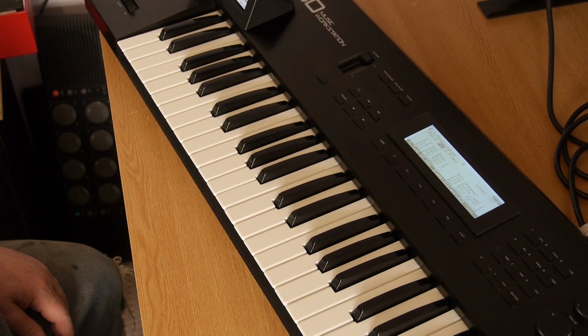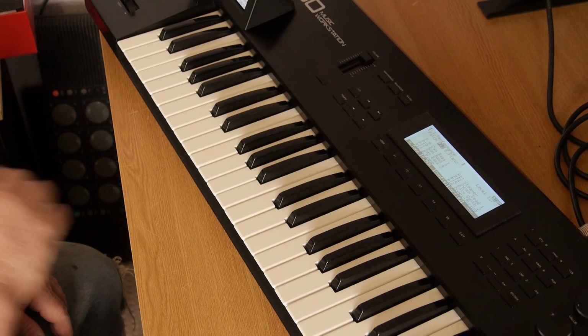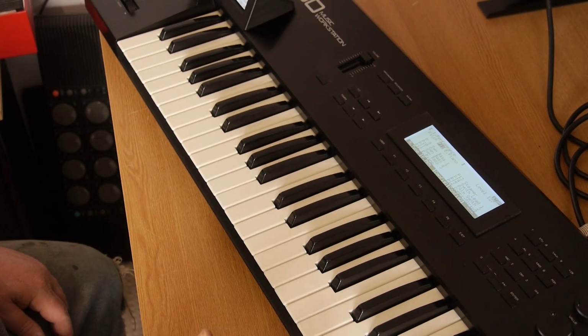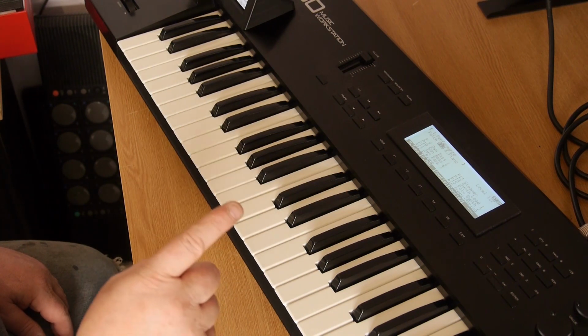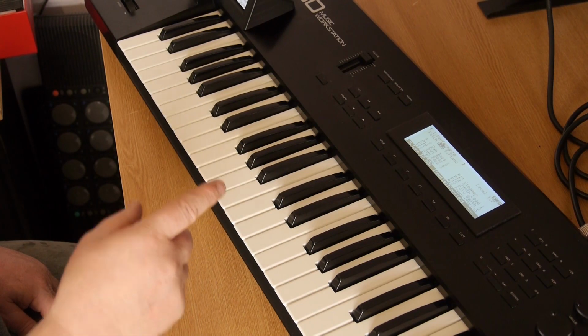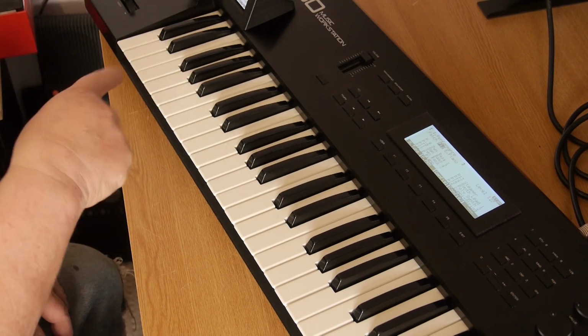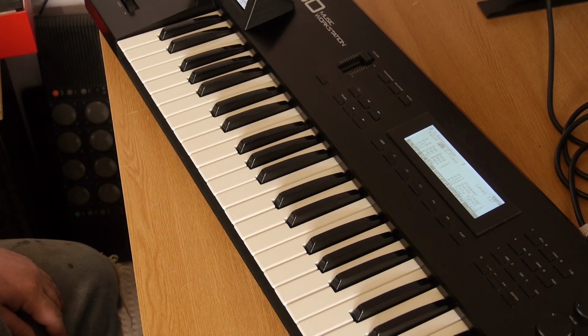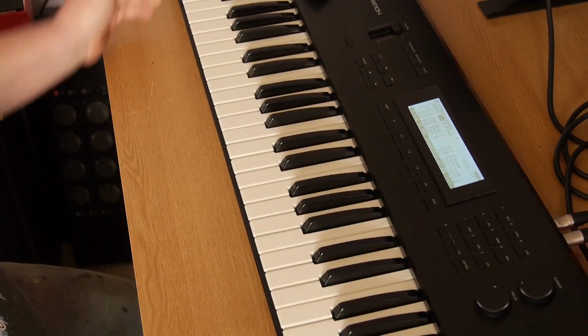So what I'm going to do is go into the software, the Flash Floppy software, and show you what you need to change in order to put it right. But we still have noise, we're still good, everything's working. Now all we need to do is alter the configuration file so that the Gotek knows that this is a SCSI system, so it'll boot off the right software. So let's get into that.